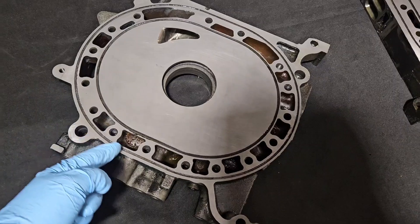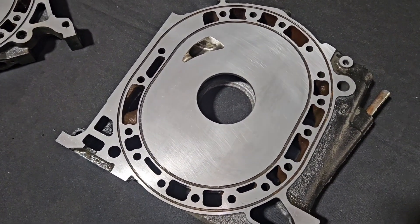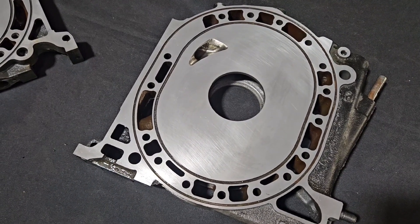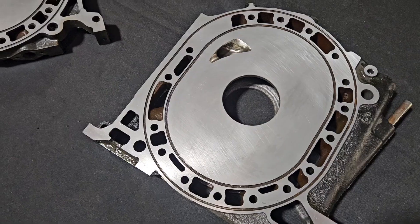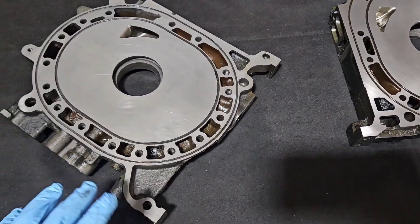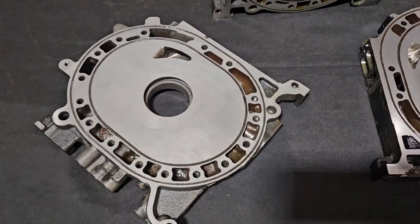It's not just your water O-rings — this whole area is a metal-to-metal seal against the rotor housing, and that's part of what maintains longevity, reliability, and proper cooling system sealing. If you've got corrosion imperfections or warping from potentially overheating in the life of the motor, that can start to deteriorate the motor's ability to seal properly. Even if it's rebuilt, if you've got those variations, you're not rebuilding to OEM specs. OEM specs say it should be flat, and you don't want anything outside of three thousandths of an inch. So if you're talking about having your side plates a little shrunken and your rotor housing a little shrunken, that can equate to a three-thousandth-of-an-inch gap, and that can cause premature water seal failure.